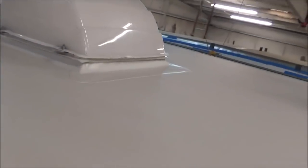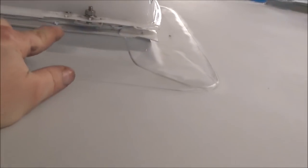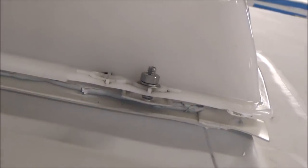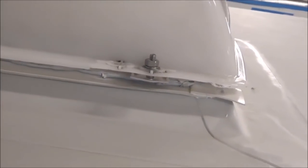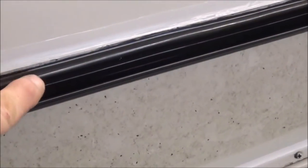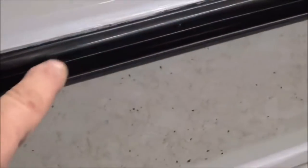So this is the counter flash that we put on here — when the water comes up it'll hit here and then it'll roll out. Even though everything is all heat welded, we've got plenty of caulking up underneath that vent right there — plenty of sealant there. The advantage to having an adhesive caulk is it actually has bonding power, so it takes a lot of stress off the screws. Even when we do the turn bar right here we do the same thing — we use the same product, we don't use butyl.